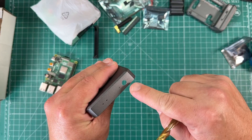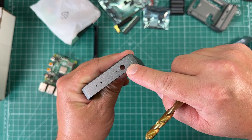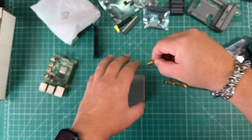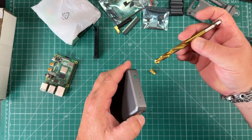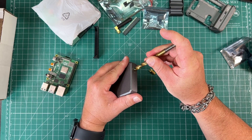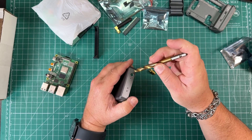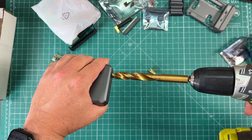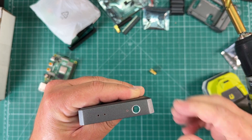We want to get a bit larger than the hole and grind away some of the paint around it so the washer has a good ground connection. He suggests using a 5/16th drill bit and just augering it out — you could use an exacto knife as well. We just go with a big half-inch bit and see what that does. There, that looks good.